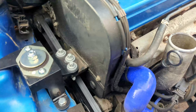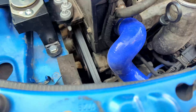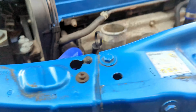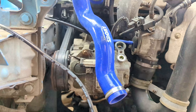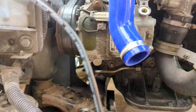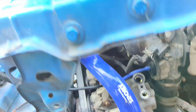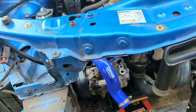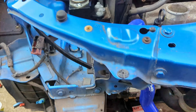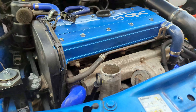I'm going to tidy up and call it a day so I don't get sick of it. Tomorrow I'll be taking the wheel arch off, draining the oil, doing the oil filter change, and taking the aux belt off while the rad's off - that's why I'm doing multiple jobs at once. While the rad's off it's really easy to unbolt the AC compressor and drop that out; there's definitely no room to drop it through the bottom otherwise. It doesn't matter that I've got loads of stuff unplugged - I'm going to just code out the AC with Opcom and the car should be fine. There's a lot to do but a solid plan for the order to do it all in.